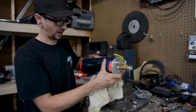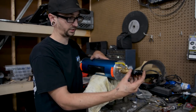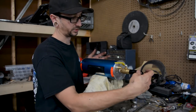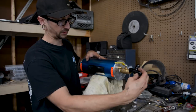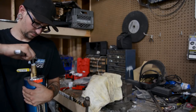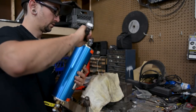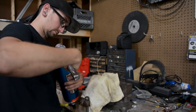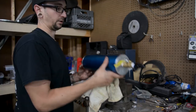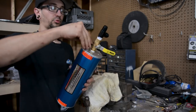With those two fittings in there, I have a general idea of how this fitting needs to go — it's going to come out facing like that. We want to be pretty much straight on with this valve just for the clearances we're looking at here. I'm going to do the same thing on this fitting: Teflon tape it, thread it in, and since it's pipe thread, we're going to get it tight and then clock it right to the position where we need it. The AccuSump is prepped and ready to go — we've got our valve on, our T-fitting, and the pressure relief is back in.